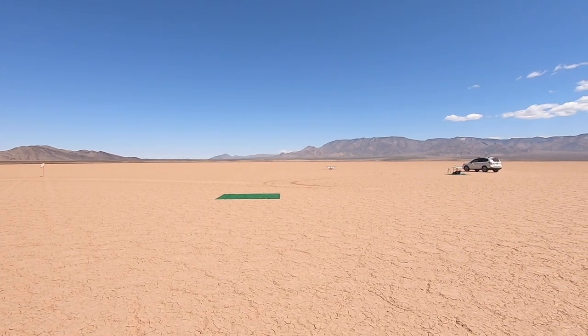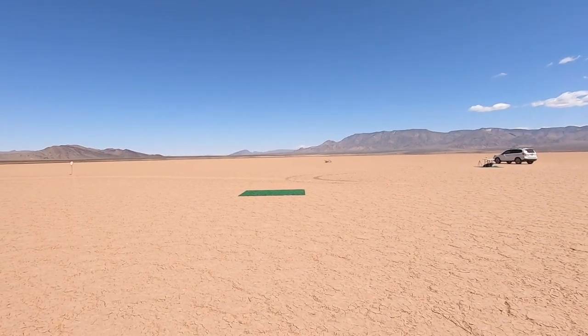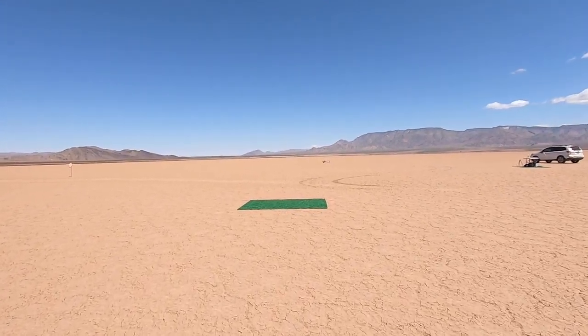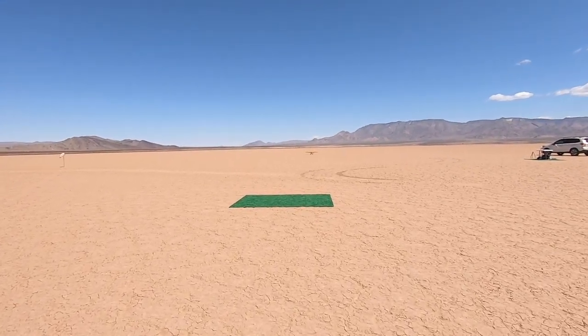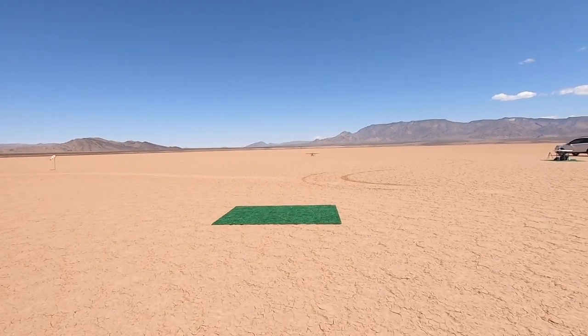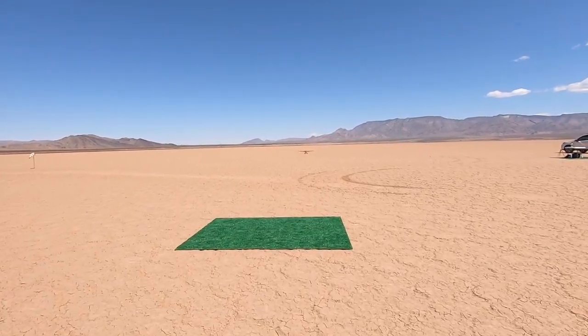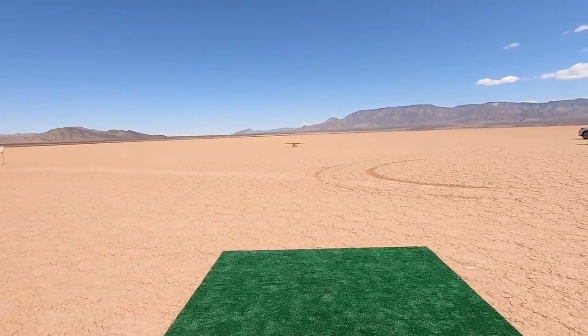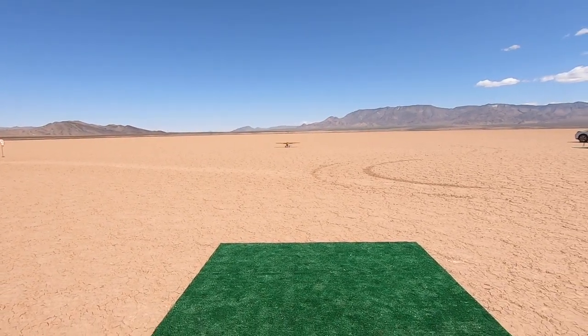Bring the nose up, a little throttle. Oh, that was nice and gentle. Look at that. So that was pretty money. Pretty money landing. No bumps, nothing. Up elevator for taxi here, trying to keep the tail down so we don't get a ground loop.